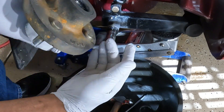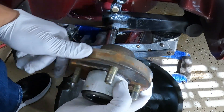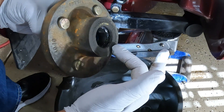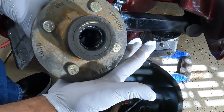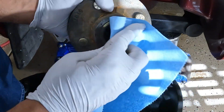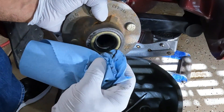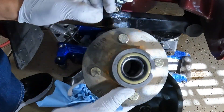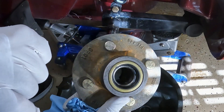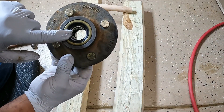This is your spindle. Now that I have the wheel hub off of the spindle, I need to remove this rear seal on the back. Once I remove the rear seal, then I can pull out the bearing. Just going to wipe some of this dirt off. When we clean the bearings, we're going to clean them with kerosene - we're not going to use gasoline, we're going to use kerosene. So I need to remove this rear seal so I can take out the inner bearing.